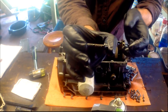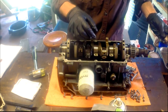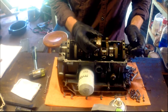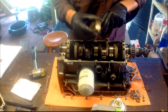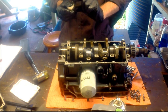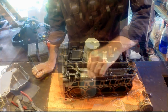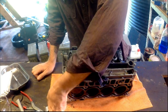Once you've got these bolts out, you can get the slipper bearing out and the con rod will be free. I'm going to take note of which cylinder these came from — this is cylinder two, so I'm keeping these in order to return them to the right place. I'll pull another piston out now and show you — they slide out from the top and still have a fair bit of oil on them.